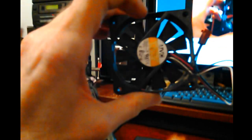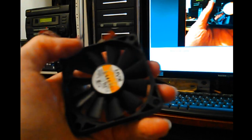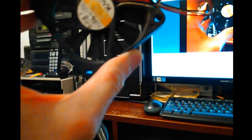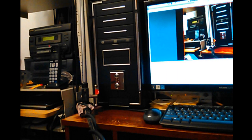Okay, now I don't know if the wireless worked all the way in the garage. That was part of my experiment, most of all. Hopefully it did, but it spins about the same as it did. But I found out that the best thing to put in these electrical fans is something like that CRC electrical cleaner, that contact cleaner is what it really is. It helps clean the bushings.